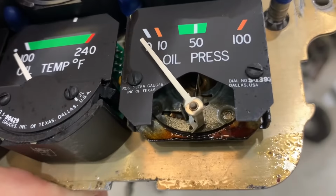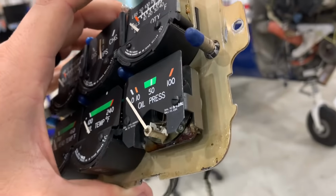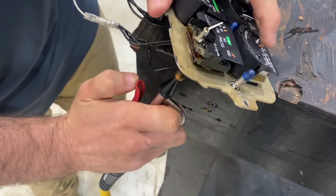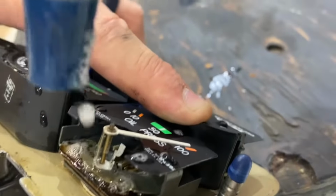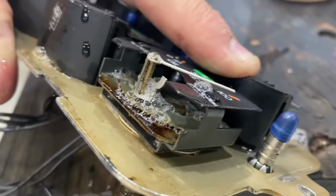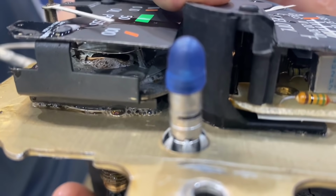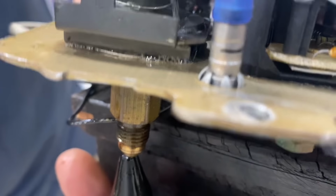So this oil pressure sensor was leaking, and it leaked onto the JPI and it fried it. So we're gonna change this oil pressure sensor out. Hopefully we can just get the sensor by itself. But I'm fixing to hook it up to air pressure so we can watch it actively blow bubbles. I see where she's leaking from. There's some more water. The bellows that comes out has a hole in it. Getting it? Yep. It ain't a big one, but that's all you need. All right.